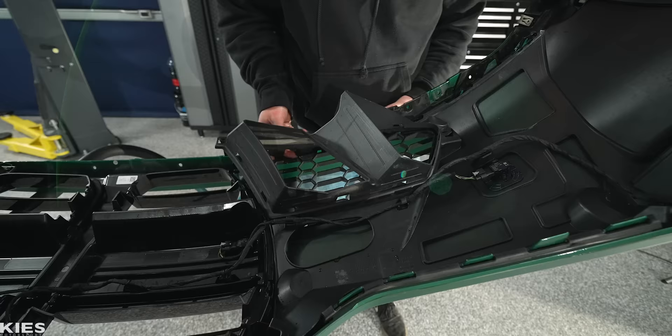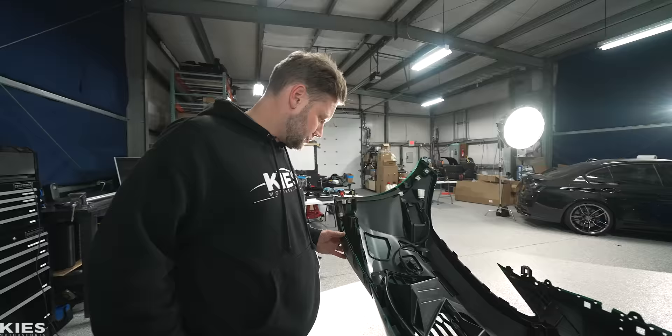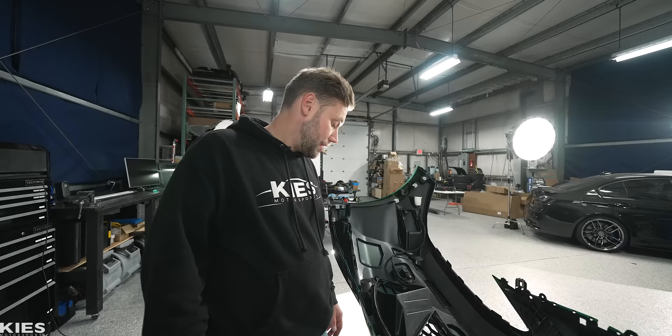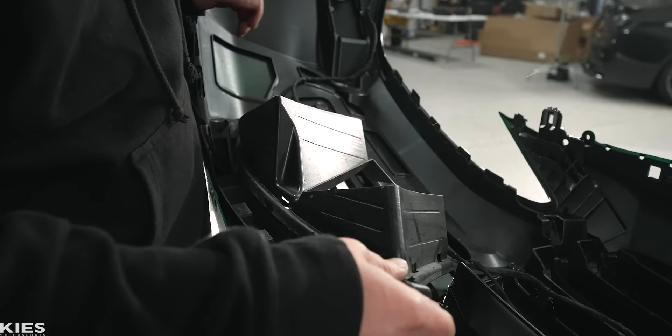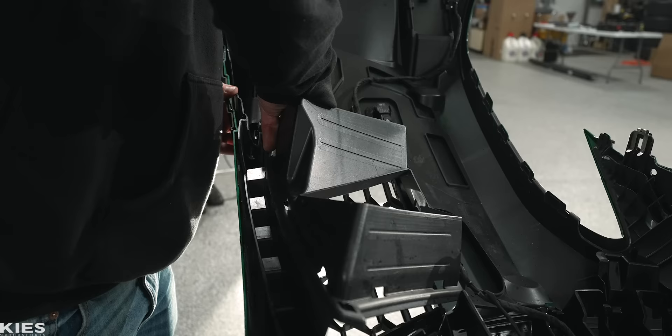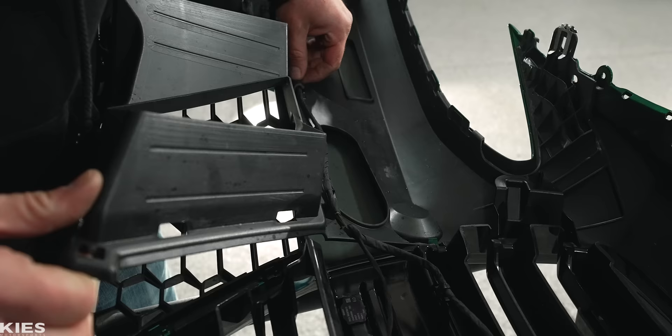Look at this thing — it's a forest in here. So this is kind of funny. We just took the bumper off and this was never clipped in. At least they did the other side — nope. What you want to do is pop this clip, then this one, this one, this one. Well, that certainly worked out in our favor. Now what we're going to do is try to get this grill out. I'm going to try to leave the bumper pretty much assembled. A lot of guys will start over here and just take out the whole inner piece. I'm going to see if there's an easier way to do it. I feel pretty encouraged because of how terribly this was all put together. Over here is going to be a little bit tricky, but I think this side should come off with relative ease — just make sure you watch your PDC cables.